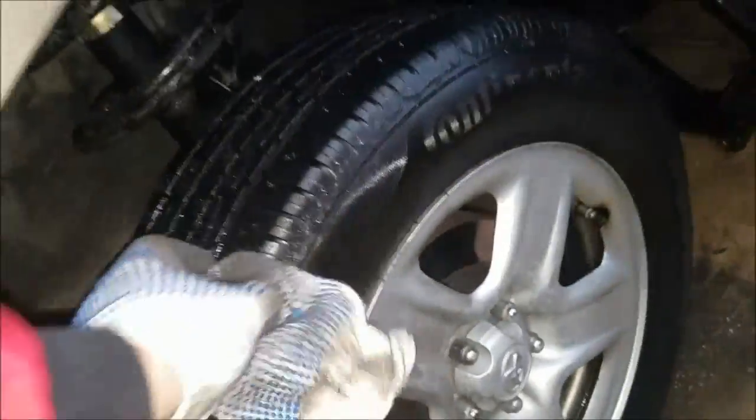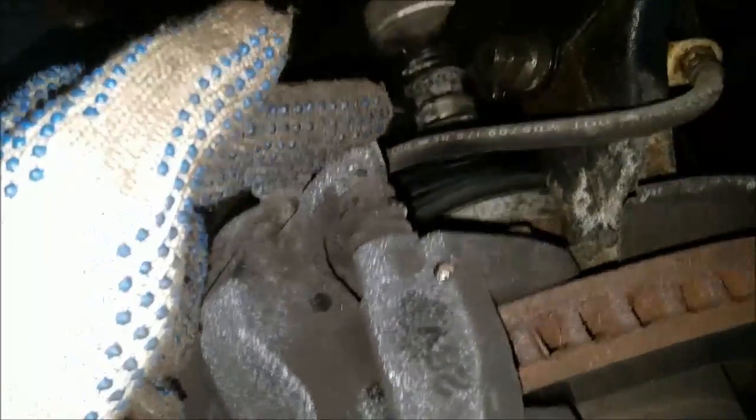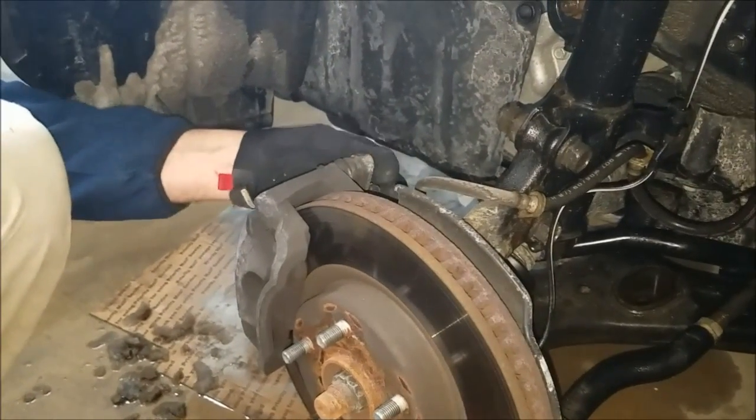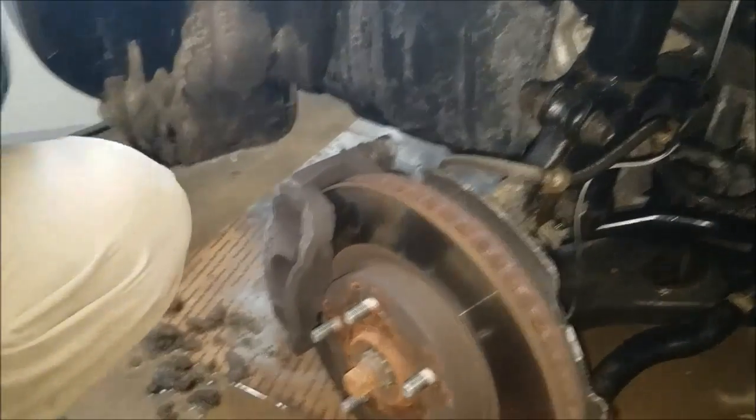Anyway, you take off these 4 bolts. And I'll show you next. So next step, what we're gonna do, these size 14 bolts, they're gonna come off, these 2, and then size 17 right there, and that's how we take the caliper off the bracket. So what he's doing right now, taking the caliper bracket bolts, size 14, first the top one, and then the bottom one.